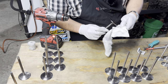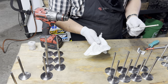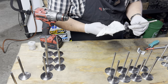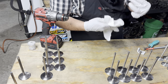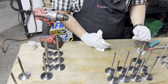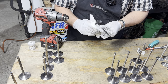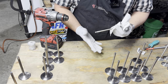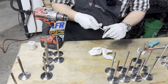Those guys are the prime example as to why titanium doesn't exactly belong in everything. Keeping things clean, having nice filtration, and doing your best to keep crap from going inside your engine is good and all, but titanium doesn't like dirt, period. The guys out there lapping their valves are probably opening themselves up to more risk than they should. You can technically get away with it, and people do every day, but you've got to be using something really, really fine. I even know of some people who will lap titanium, or a valve in general, using just toothpaste, and that works just fine.